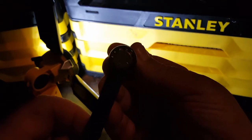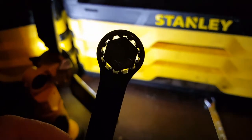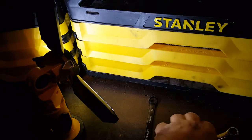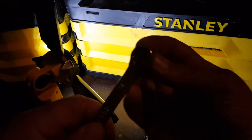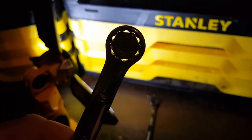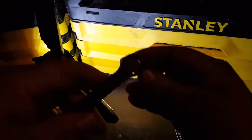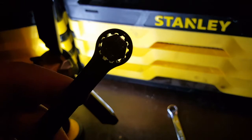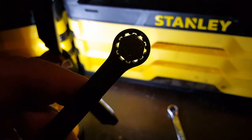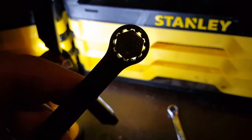Here's a 14-millimeter bolt. I have the light up here so you can see it easier. See that right there — it's covering the surface a lot more than a 12-point, which I'll show you. When you put on a 12-point, it is covering a lot less surface than that spline drive. But still, I would not try to break off a bolt with the spline drive at all. If you have a stuck bolt, use a six-point — something with a lot of contact surface.